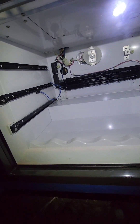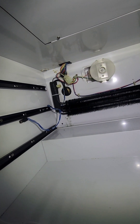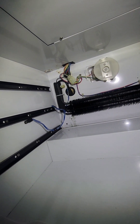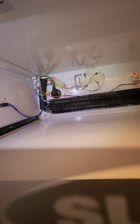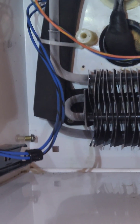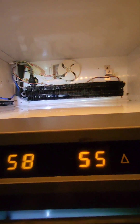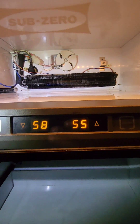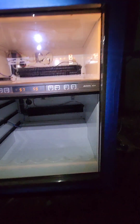Just wrapping up this wine cooler. You can see the three-way valve is on and the lower evaporator assembly is on — you can see the capillary tube over there getting nice and icy in the corner. The upper unit was just on, the evaporator coil is still nice and icy, and it just cut off and switched to the lower section. I have it set right now at upper 55, lower 55. I'm going to see if it gets to temperature and holds, then lower it some more to make sure everything's working properly.